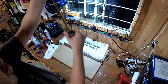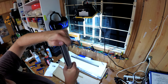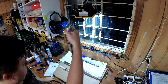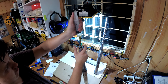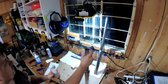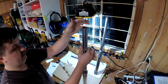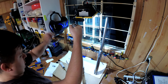This fork is good to go. We can put the spring back in and tighten up the top screw. This is tricky. That's one — it's not fully tight, but we can do these up to torque when they're already in the bike. Let's do the second one. Approximately 150 cc's again, but this one won't matter too much because we have our level setter. First time doing a fork rebuild like this, by the way. I have done an R6 fork set before, but for some reason that was a lot easier. Let's get the spring into this one. There we go. And that's that.